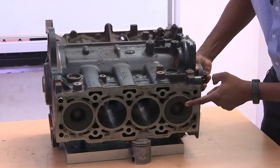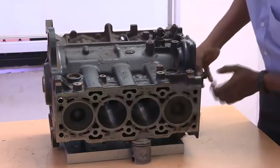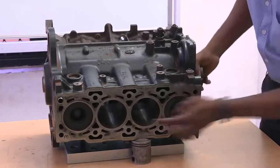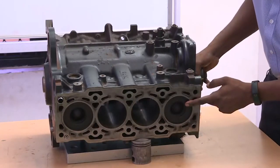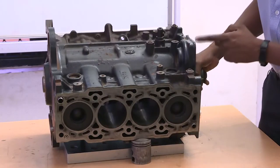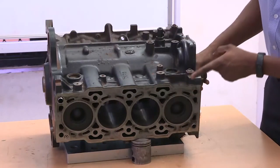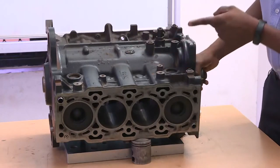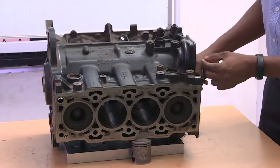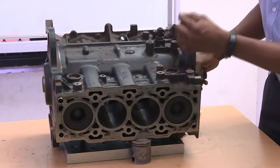Now this is what the piston is. This is piston number 1, 2, 3, and 4. As I rotate the crankshaft, you would see that piston 1 and piston number 4 are moving in parallel. That is, piston 1 and 4 move together at any given time of crankshaft rotation. So piston 1 and 4 are known as a pair. Similarly, piston 2 and piston 3 would be moving in a pair, but pair 1 and 4 and pair 2 and 3 are shifted in phase by 180 degrees.